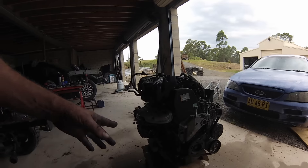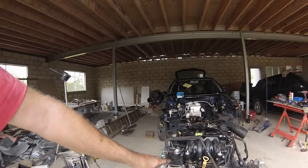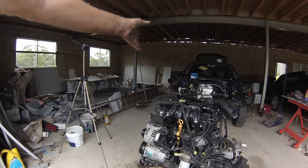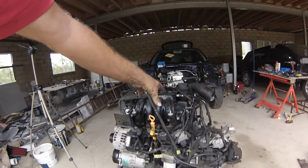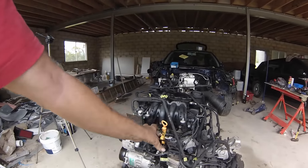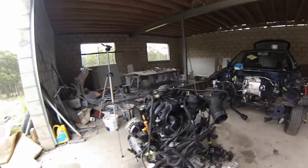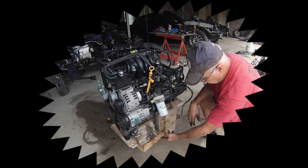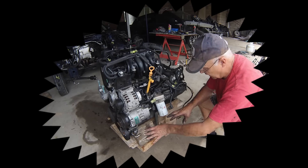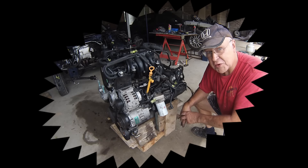So it's going to go backwards and forwards on that trolley in and out of the Golf. And if I have to lift this engine over the top and put it into the Mark 1 Golf, the stand and trolley will go with it, because it will position the car. If I need to fabricate mounts or anything like that, I just drop the whole 1.6 motor on the trolley into the Mark 1 Golf, which isn't here yet, and that positions it relative to the ground. Putting this simple wheel trolley underneath the engine and building it up with chocks, screwed in place so it's sitting at the exact right angle in every way for the transplant positioning - that's one of the secrets of Redline's easy engine swaps.